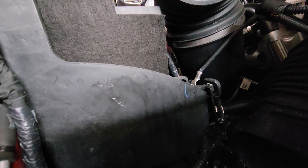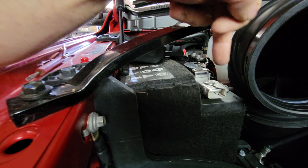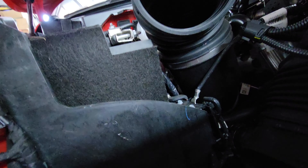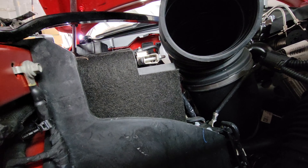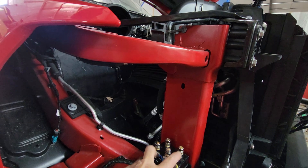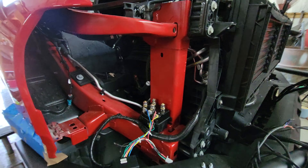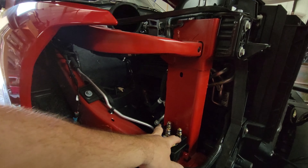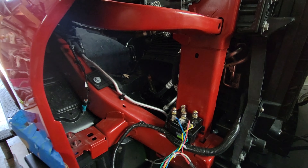The winch can pull upwards of 340 amps at peak, so we're probably going to ground this either directly to the battery itself up here, or to the actual frame of the truck so it gets a good solid ground. There's another lug back here coming straight down from the battery terminal that we may use — I've just got to pull this hose back and see how it's configured. The problem I'm trying to emphasize is this relocation. There is no room in the bumper, there is no room under the hood, and putting this thing inside the cab isn't really a feasible option.